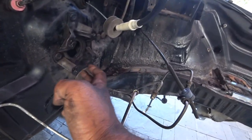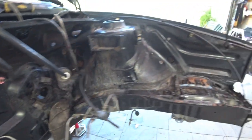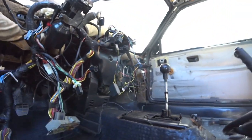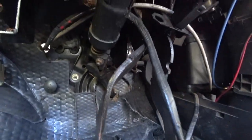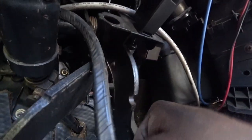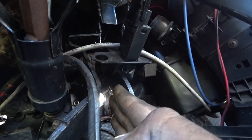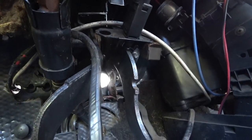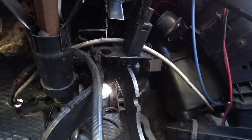Once you remove the four bolts behind the brake booster, inside the car, you're going to need a flathead screwdriver. I didn't give you guys a video of it because it was actually kind of a tight fit. But you see here on the brake pedal, right where my finger is, you need a flathead screwdriver. There's a little bracket you bend out and push out and then push the pin out. It's really simple and then the brake booster pops right out — nothing crazy difficult to do, pretty straightforward.